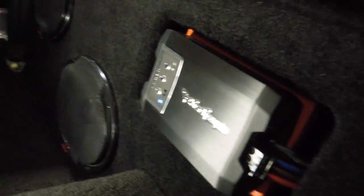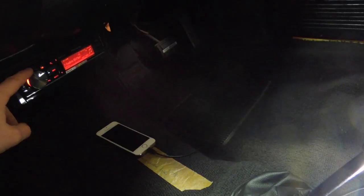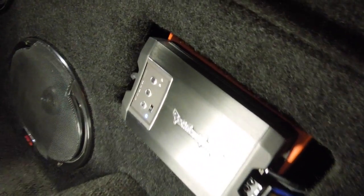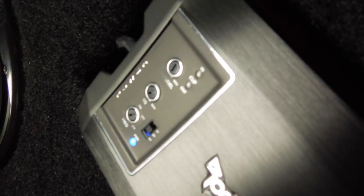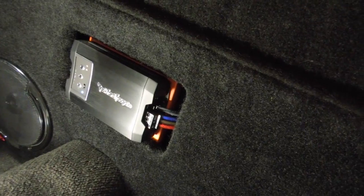For tuning it, I used the built-in Rockford Fosgate clean system — absolute zero clipping. This head unit goes to 61 out of 62 without clipping, and I was able to tune the gain up to around 49% before distortion happened. So it works really well.